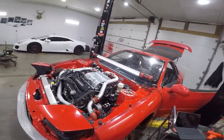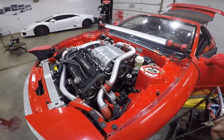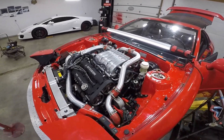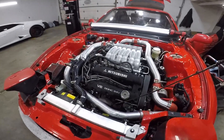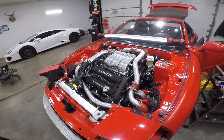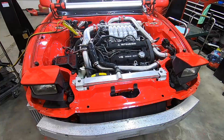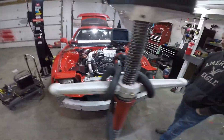I'm so excited — it fired right up. I really didn't think it was gonna be that easy; I thought we were gonna be stumbling with timing for a little bit. Like Adrian just said, it does help when the cams are in right the first time. I have no fuel in my oil either. When Story Motors rebuilt this the first time I started it up, my oil was immediately like 50% fuel — so watery. This doesn't even smell like fuel yet. Those rings seated right away, probably because this build reused the old rings and pistons. Everything's going good boys — let's fire this thing up one more time.